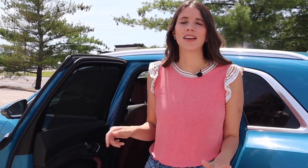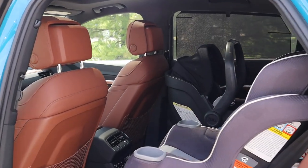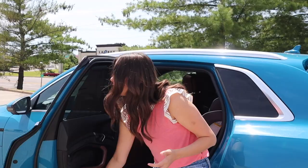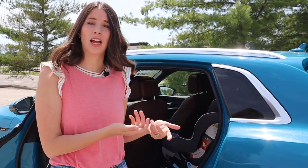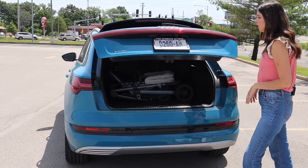Headrests are not removable but are adjustable, and I was able to install a forward-facing seat securely. Today I have a Graco Extend2Fit forward-facing and a Maxi-Cosi Pria in the outboard seats. Sitting in the middle between both car seats didn't work well — the seat belts are a little wonky with some overlap, and the outboard seat belts are rigid. I installed the Maxi-Cosi with LATCH and the Graco with the seat belt. Three-across could be difficult — not impossible, but with this combo it's a no-go. Consult a certified Child Passenger Safety Technician for your specific setup.